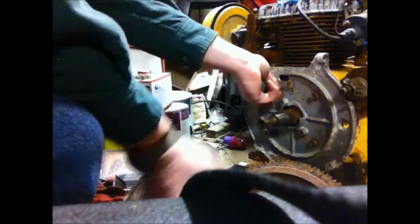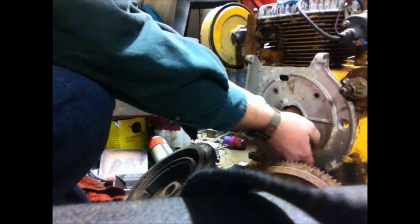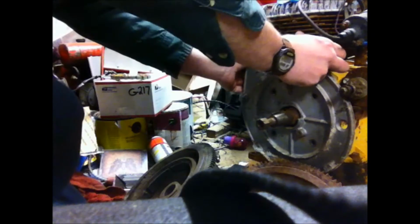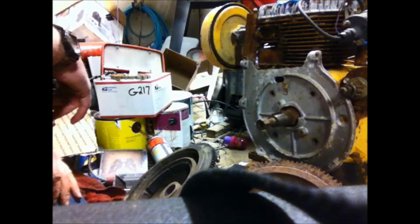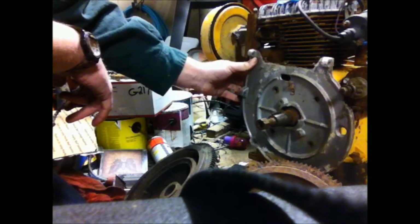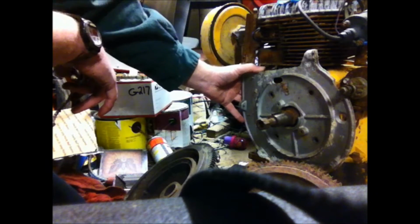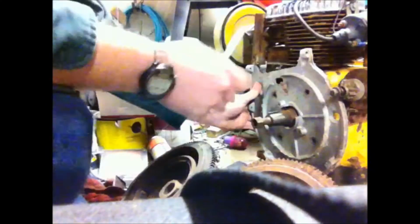There's just these 4 bolts. You can take them out. Now, give it a little persuasion. There we go. Now, I was afraid this might happen. The bearing seems to be kind of hung up on the crankshaft from getting it off, so we may have to try some finagling here somehow, and it may make this a little harder than I wanted it to be. Let's see if we can get lucky here and just press on it. Now, I don't care if I screw up this bearing plate because I'm never going to use it again.